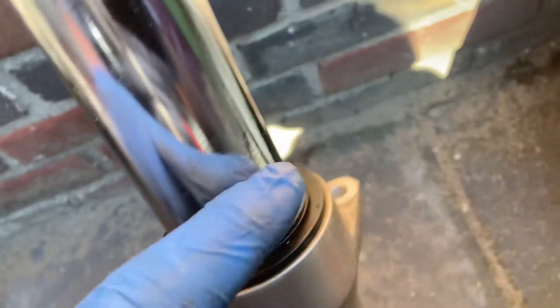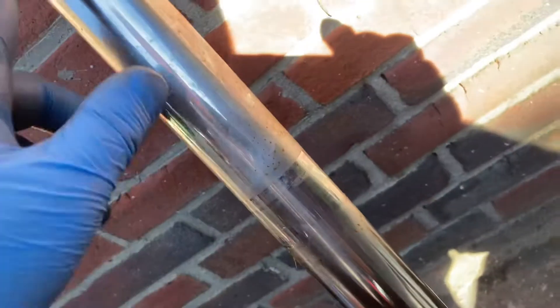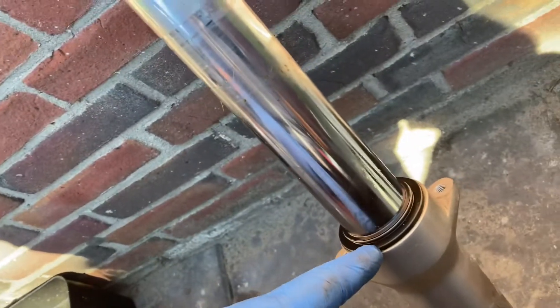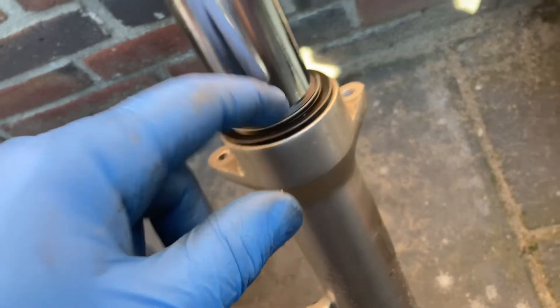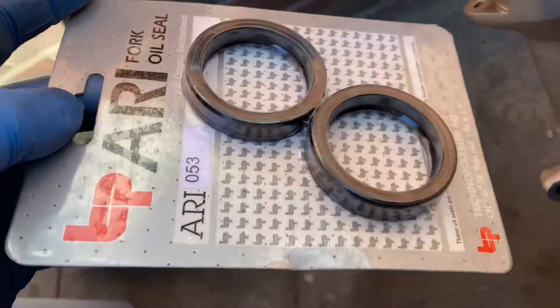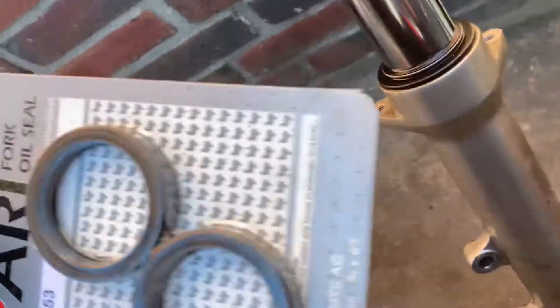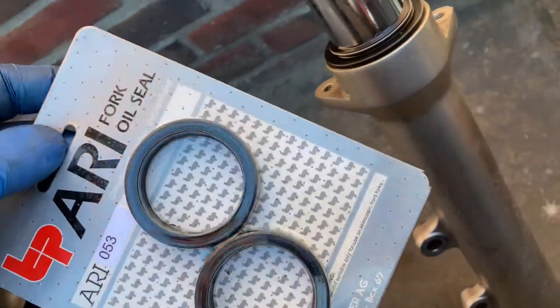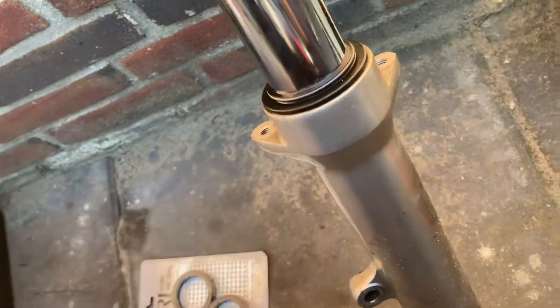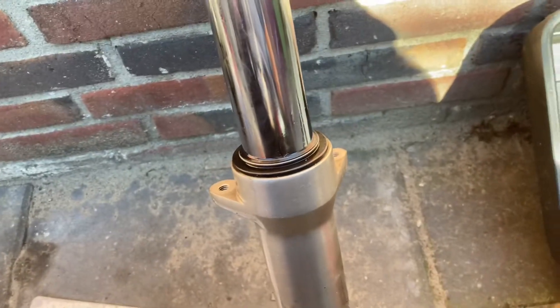The fork is out — you can see there is a lot of oil, and I'm going to clean it up a little bit and then take it apart. There is a bolt at the bottom that has to be opened, and then I can pull everything apart. That is going to be the last step: pull out the old seal and replace it with the new one. Of course I have to do the other fork as well, with new oil and new seal, so both forks are going to be done at the same level.